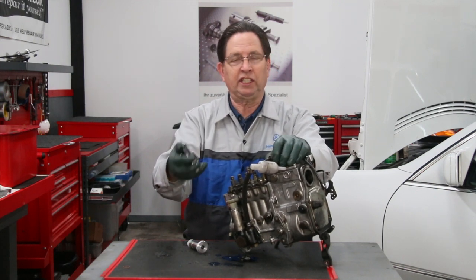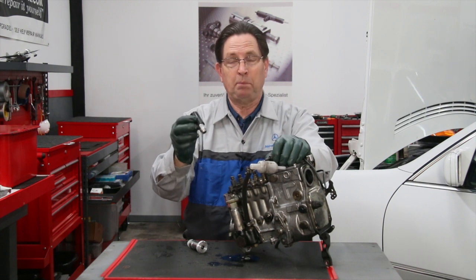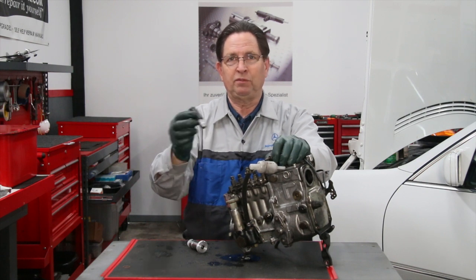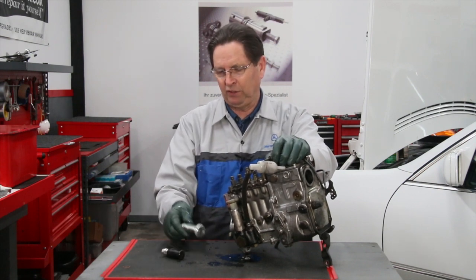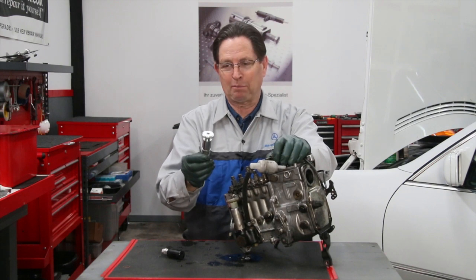This here is the Bosch — it doesn't unscrew, you just get down there and pump. But it has some limitations: number one, it has a very short stroke so it doesn't have a lot of pumping volume. The other thing is it will not move heavy fuels — if you're running some sort of veggie fuel or SVO mix in your engine, these primer pumps don't work.